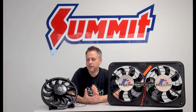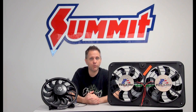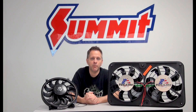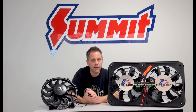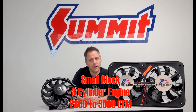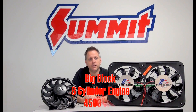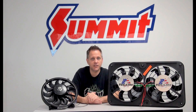Once you've decided on a type of electric fan — push, pull, or reversible — there are a couple other important considerations. Chief among them is airflow, or how much air you're going to push or pull through your radiator. Here are a few rules of thumb: for a four-cylinder engine, you want a fan delivering between 1,300 and 1,600 CFM. For a six-cylinder engine, you want to be up in the 2,000 CFM range. For a smaller cubic inch V8, 2,800 to 3,000 CFM. And for a larger cubic inch V8 engine, you're going to look at 4,500 CFM or higher, depending on the size of your engine.